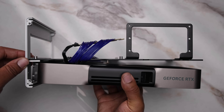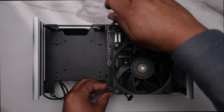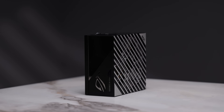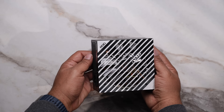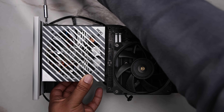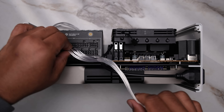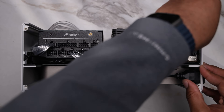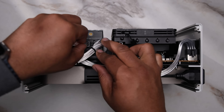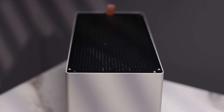Because the card maxes out at 305 millimeters, we need to remove the front panel so the 5080 can slide cleanly into the case. The fully assembled board mounts upside down, so the PCI slot is on the top. Next, the power supply — the Asus ROG Loki 750-watt platinum, which goes really well with this build. This is an SFX-L unit, which makes cable managing and installing the bottom case fan a bit more challenging. With the help of some zip ties and clever routing, we managed to get the fan installed. 16 screws secure the top, bottom, and side panels, and that's your build complete.